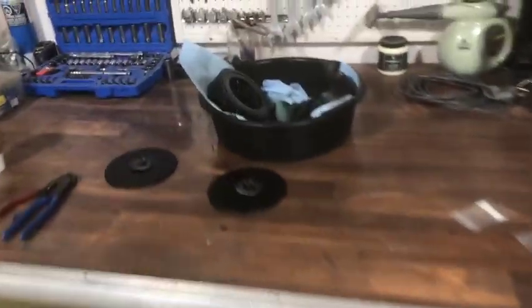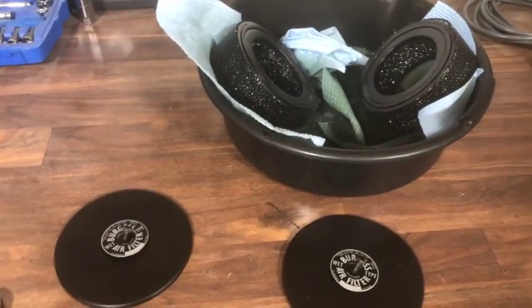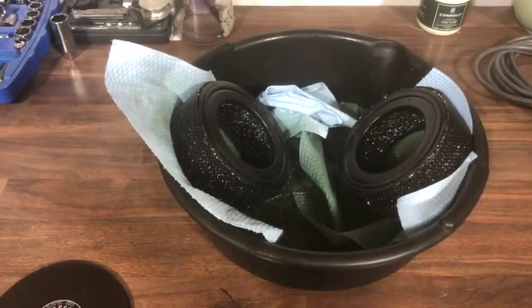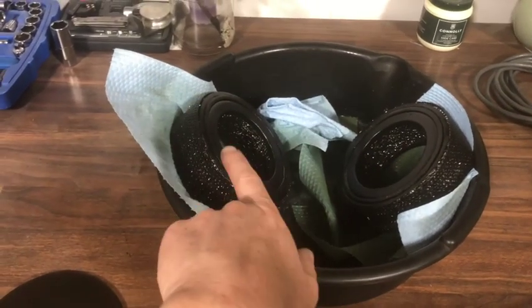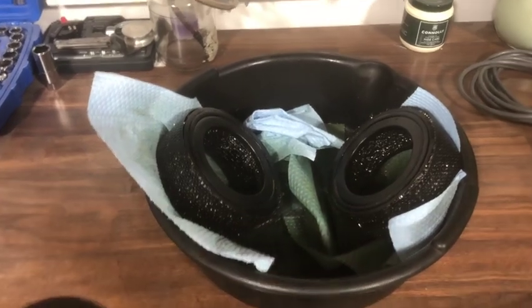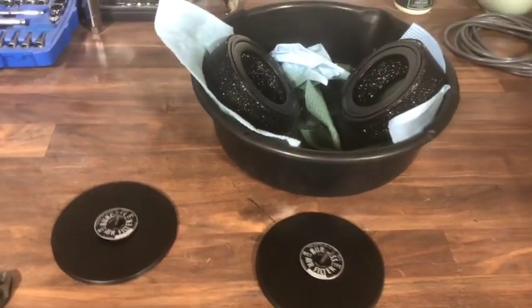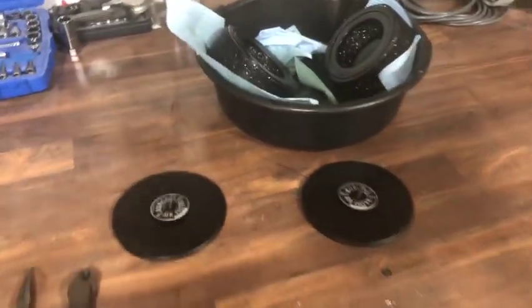And then with those air filters, as you can see, of course I restored these and they've been washed out in petrol and Varsol and then dried. And now I've soaked them in oil and let them drain overnight. So now they're ready to install. As per, that's what they say to do in the manual. So, what else have I done?